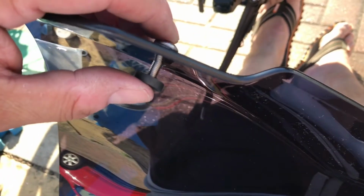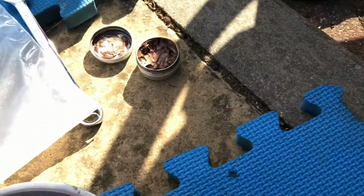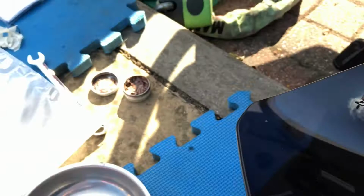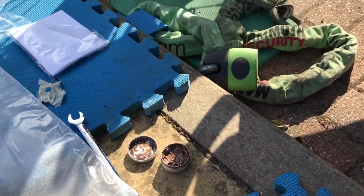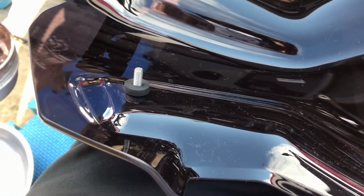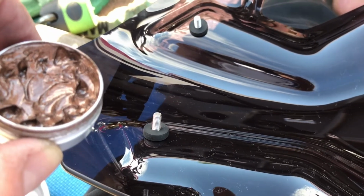A little bit awkward maybe lining them up, but I'm going to get my able assistant, in other words my wife, to help. Okay, another little tip I thought of, you can see I just put those on there, is this stuff. These well nuts, rubber captive nuts, whatever other people call them, they're notorious for being buggers, i.e. they seize up or people over tighten them or what have you. So I've had a few that I've had to drill out. I just put a bit of copper grease or ali grease on the threads, just so they go in and out a little bit easier, and adds a bit of protection as well. Just my two pennies worth.